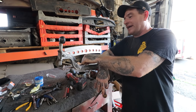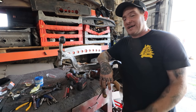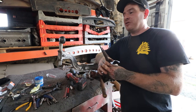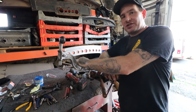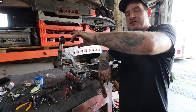When you go to put it back together with that ridge, you have to smash it together with a hammer, which you don't want to do. You want things to go together by hand for the most part, and maybe just a light tapping with a small hammer on some of the stuff. But the kingpin and the spring perches should basically just drop in by hand. There should be no major play. Try to just spin them around.